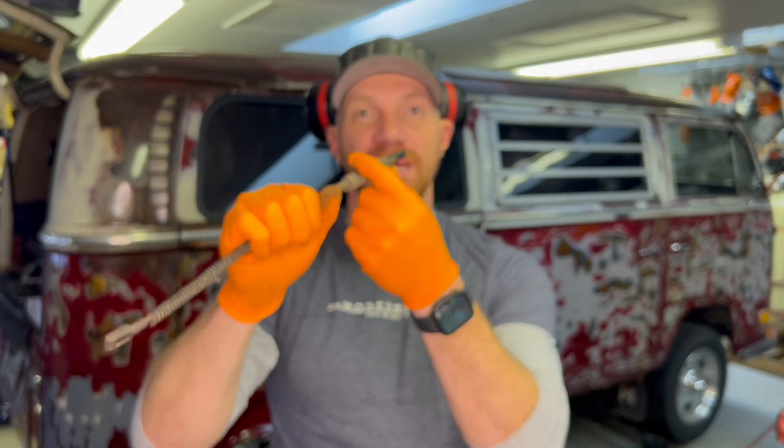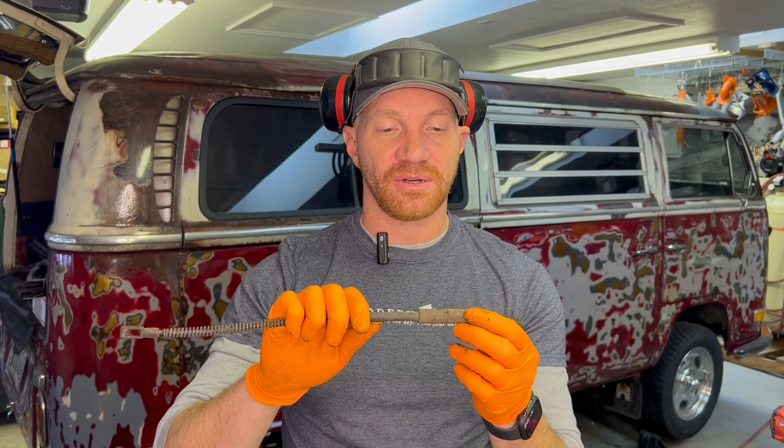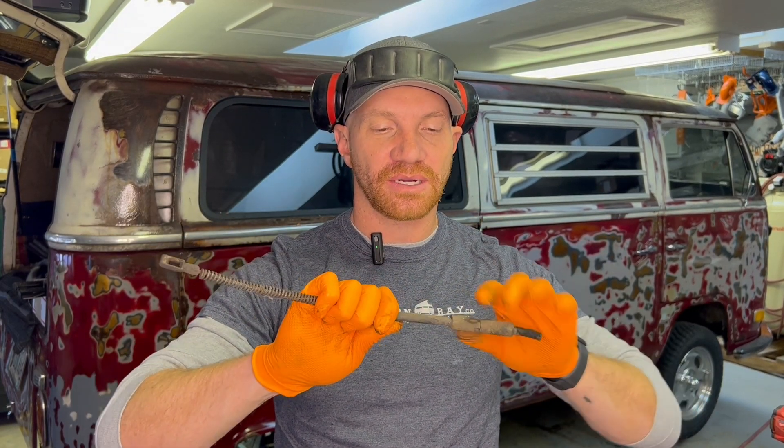Something else to look out for: emergency brake cables. I always replace all this stuff — I don't want my clients to have any problems, so I recommend replacing it if it's original or showing any problems. This is what's left of the e-brake cable — I just nipped these off to get them out easily. Right where this e-brake cable goes under the spring plate on the rear suspension, on this bus after about 51 years of use it has worn through the outer sheathing. Thankfully the inner sheathing is still okay, but at some point it would start wearing through that too. I've never actually seen it wear all the way through unless it's a severely lowered bus, but I very often see this outer wear, and the emergency brake is kind of important, so you want to make sure it's working like it should.